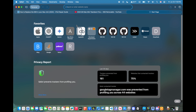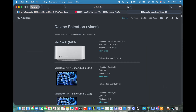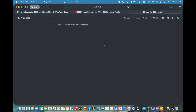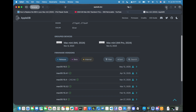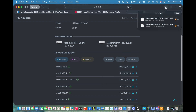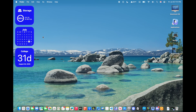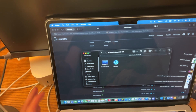Now we're going to install macOS on this. We're going to go to appledb.dev to get an IPSW file for our Mac Mini. It doesn't really matter which device we choose — they all use the same IPSW file. We're going to go with 15.5 and Mac Mini M4. These dropdowns do show up with Mac Mini M4 and M4 Pro, so we're just going to download it. It stopped — we're going to try again. It needs more storage cleared on this MacBook. Our IPSW file is right here, so now I'm going to turn the Mac Mini on.